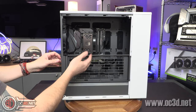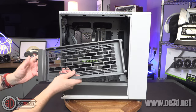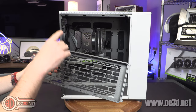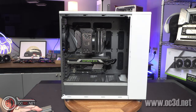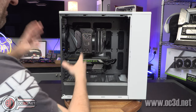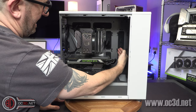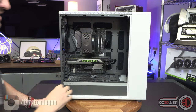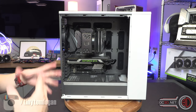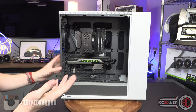When we open the inside out, you see this panel and it only comes on the mesh case for obvious reasons — if it was tempered glass it wouldn't be able to work. You can fit two 120s or two 140mm fans to it for even more airflow, so if you want to max it out you've got loads of air you can direct at your graphics card. This case actually has motherboard mounts all the way out to the side for huge motherboards — server or very high-end workstation kind of environments.